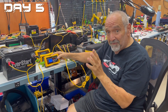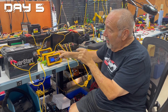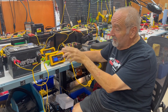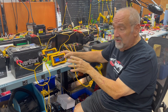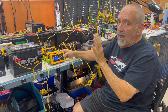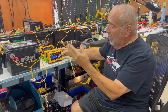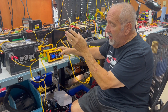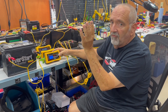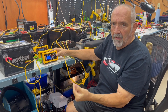It's been three days since we put this on, and to my delight, it is completely charged up all the way. It brought this $2 battery back to life — as amazing as that sounds, this battery can be used again. I'm sure it's not perfect because it is 14 years old, but it can be used. So the next thing I'm going to do is take the charger off and put a carbon pile load tester — a good old-fashioned cheap load tester — on there and see how strong it is.